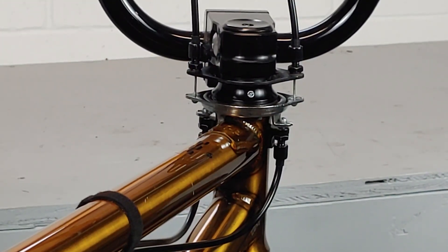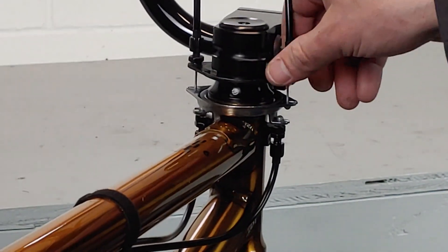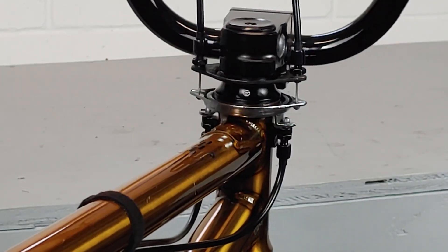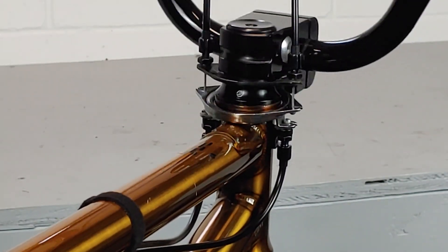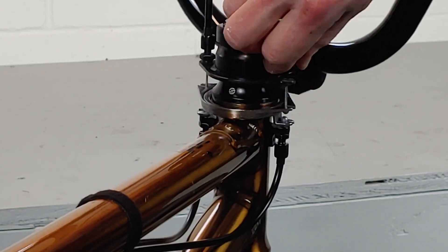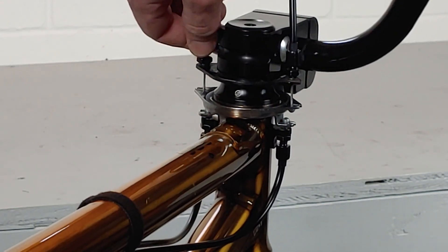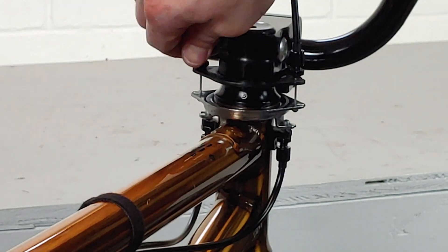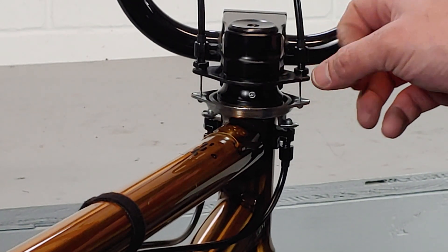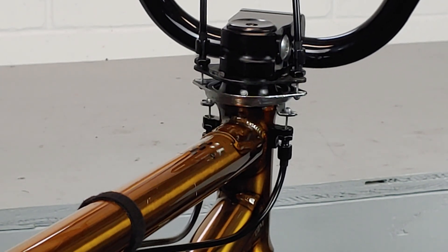The last problem I'm going to get into is gyro flip-flop — that's where when you turn the handlebars back and forth, the gyro flips one way and then flops back when you turn it back. I demonstrated that by making my gyro uneven on purpose. To get rid of it, you just turn one side up and the other side down to even out your gyro, making sure the unit is still hovering off of those bottom cable stops. Once you get it adjusted right, tighten it down.